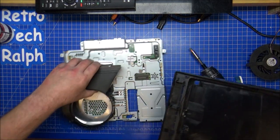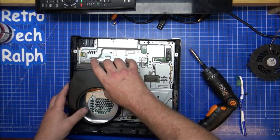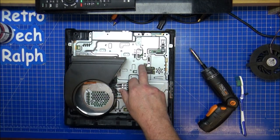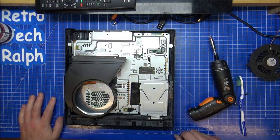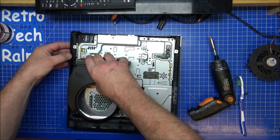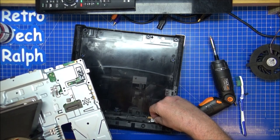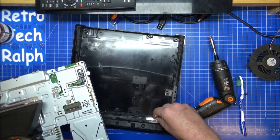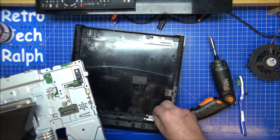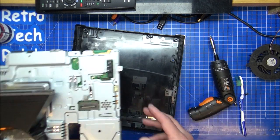Now, on with full construction again. I know I've forgotten something there. That goes in, I need power supply on, I need the cables going across here now for the Wi-Fi and the Bluetooth, fan in, more screws holding this to the chassis, is there not? Yeah, watch out for that piece of metal on the front, it goes in one way only, and it's a pain in the bum to figure out which way it is. Yeah, because that goes on, oh, that way, there we go.